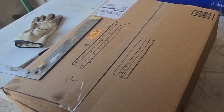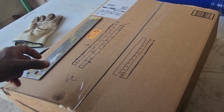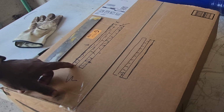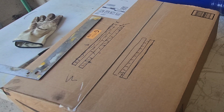I mean, if it's a super heavy duty, something like an F250 where there's a lot of mass and you can cut it and the difference in thickness is negligible, fine. But on a passenger car where these discs are already as thin as the manufacturer can get away with, you cut them down, you're gonna run into problems really fast. So if the rotors originally lasted, let's say, 2 years, and you get them cut, you'll be lucky to get 6 months out of them after the fact.